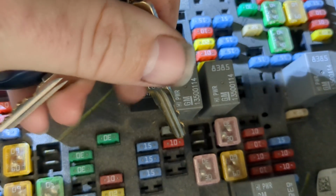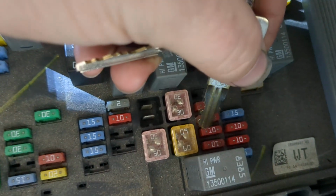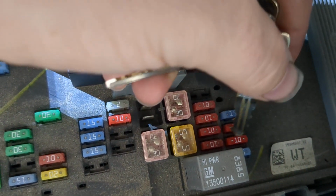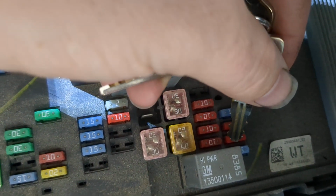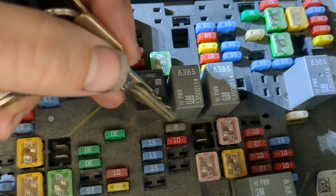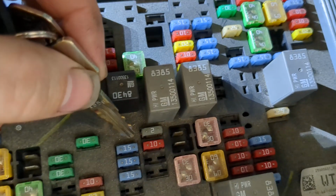In researching all of this on all the forums, I found a guy who said, you've got to pull this one and this one and this one. And so I started reading about what those were and realized that this one was missing. So I put a new fuse in and everything works great. The blend door actuators are working. I now have 3 of them. I may test them to see if they were actually bad.